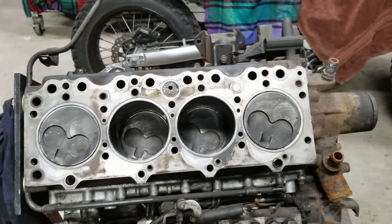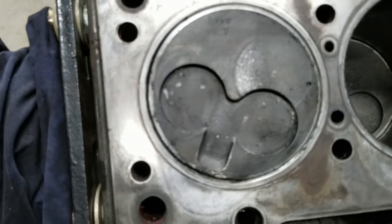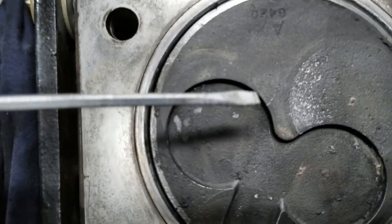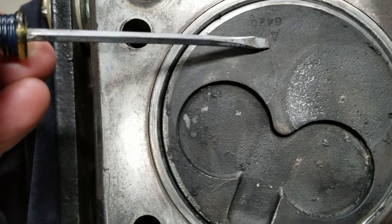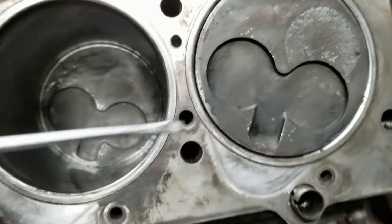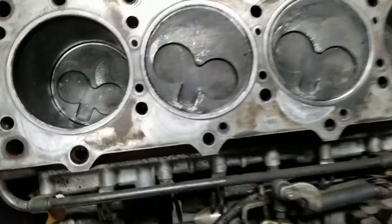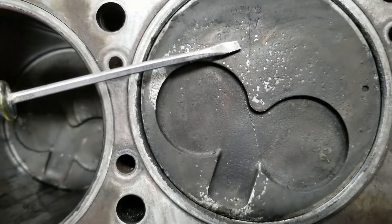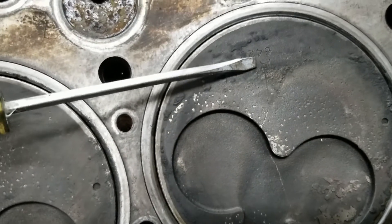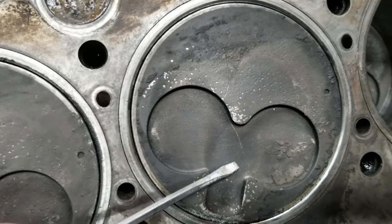They say that if the news is bad, it's really bad — and that's kind of the situation here. I don't know if the camera is going to pick this up, but you can see the crack. There's a hairline crack right here that goes from the size stamp all the way through, and it kind of stops right there at the valve valley. Number four — same scenario, there's a crack going all the way through. Number two, there's a crack running right down all the way to the valve seat. Number three — same scenario. Little crack right there.